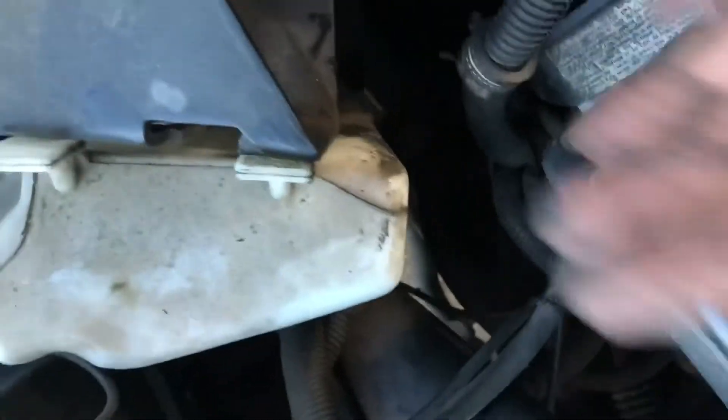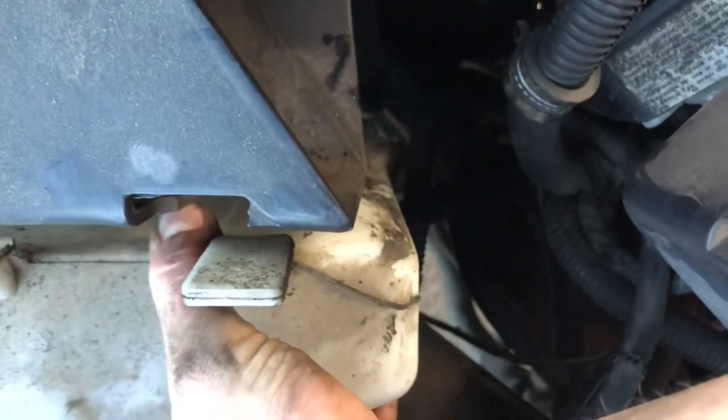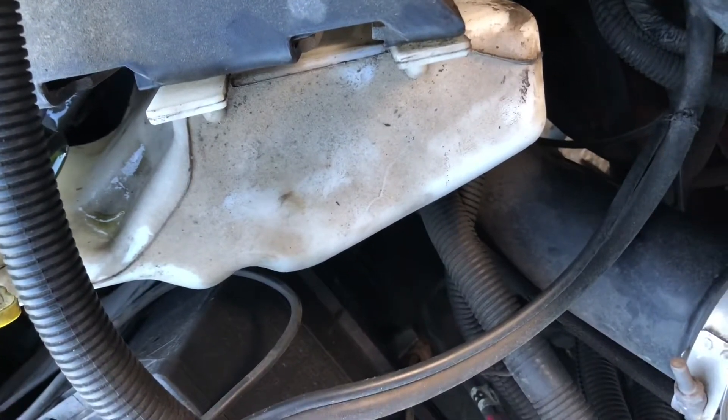There's the drain right there on the driver's side. I'm going to go ahead and get a bucket and put it under there and start draining that down. To get the coolant reservoir off, take a long flat-blade screwdriver — or a Phillips works too — wedge it in between the fan shroud and the reservoir. You've got to push those two little indents out since they have a locking hole. Once you push them out, you can lift the coolant bottle up and get it out of the way.